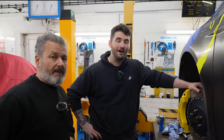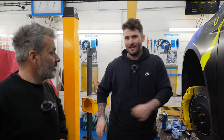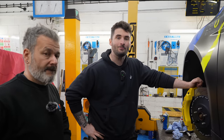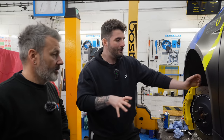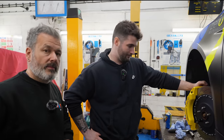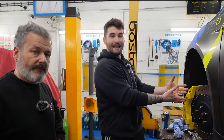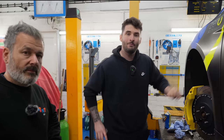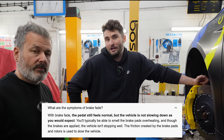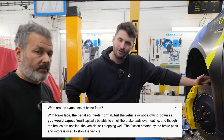Right, guys, over the years I've learned a fair amount from quite a few people that I've been making videos with. Martin in particular has given me an experience, let's just say that, in a Fiesta. When we did that, he taught me a little trade secret that he gives to his customers when they purchase big brakes here at MJ Performance. What I'm going to tell you might shock you. Brakes actually make you faster. The reason being is, of course, big brakes will allow you to slow down more efficiently on the roads, but better still, when you're out on a track day, they'll also reduce brake fade. Brake fade can be really annoying because naturally your track time will not be utilized properly if your brakes don't work and you can't do as many laps.